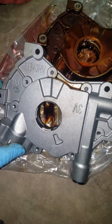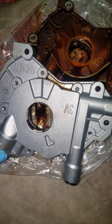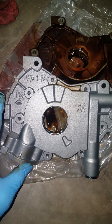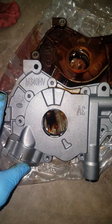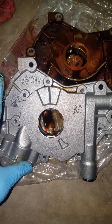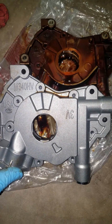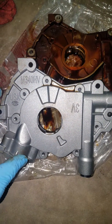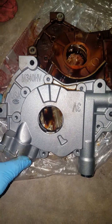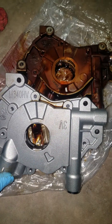If you've got a lot of mileage on your engine, it's got some bearing wear, camshaft wear, head wear, it's a good idea to put one of these HVs on there. It won't increase your oil pressure, but it will increase the volume. So if you do have a problem with oil pressure — having low pressure because of tolerances being too big around the bearings and cams — then this will feed it enough oil, give it more oil to make the engine run properly.